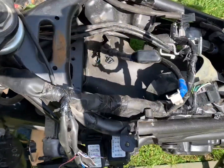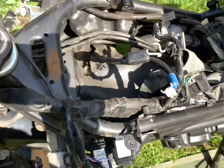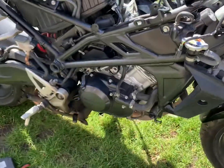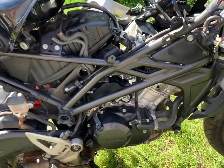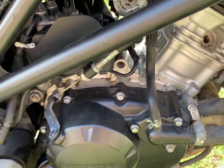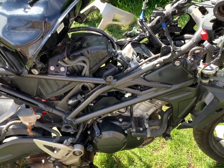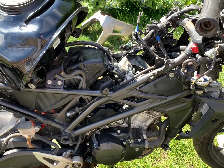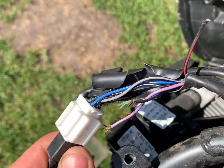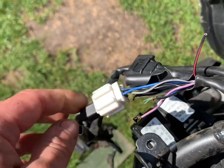The bike is rapidly turning into a problem. I've had to strip out the battery and a few plastics — the bike isn't sparking. When you get a bike like this, the first thing before you start doing any work is to check that the engine sparks and the engine runs. If the engine doesn't run, don't rebuild the bike until you've got that sorted first. I think it might just be these three cut wires.